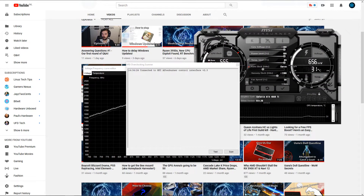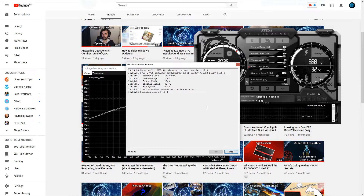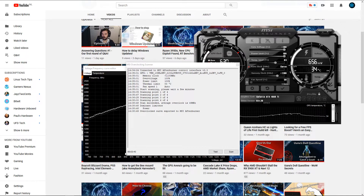With all three sliders at max and voltage control enabled in settings, click Scan to get the process started. It will test your graphics card at different points of the voltage-frequency curve, find the highest stable point, and set your card to that. As I said, it's not as thorough as manual overclocking, but it's a very easy-to-use alternative that I've found pretty stable and reliable. After roughly three and a half minutes, the scan has finished and succeeded.